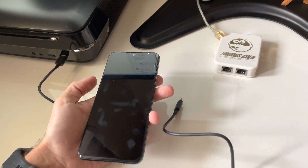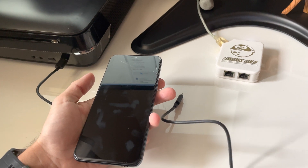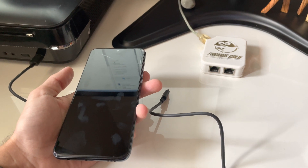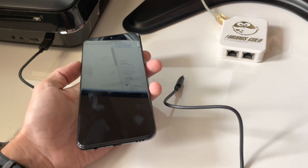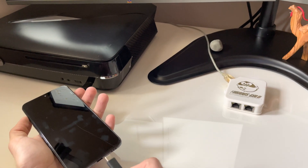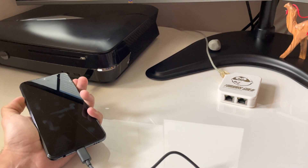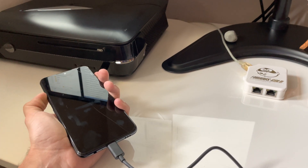But there is still one step to do before totally restoring it. As you can see, it's on a boot loop. And after several failed power-ons, it's going to display an error message. So, while the phone is boot looping, I'm going to keep pressing the volume up button and insert the USB cable, and we are going to keep it like this until the phone enters download mode.